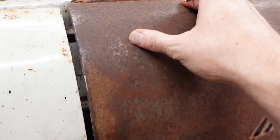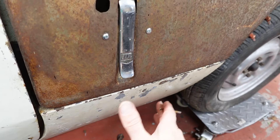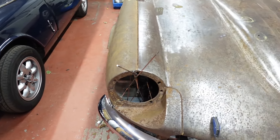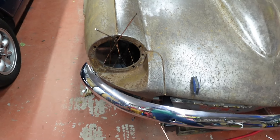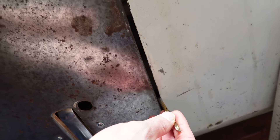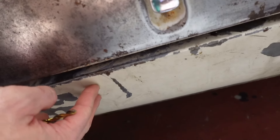I'm kind of happy to stick with this for the moment, because this wing's going to change. This is too tight — the sill's got to change, the wing's got to change. We've built that right, and that means all the hinges — all this mess here that had to be built out of thin air — is letting the bonnet fit fine. This one's a bit weird because that's 5mm and it gets tight and then it gets fine all the way up, and I think it's actually the wing. This gap down here is huge, but this sill is a replacement.